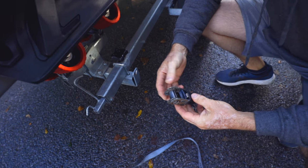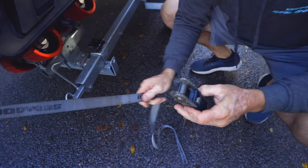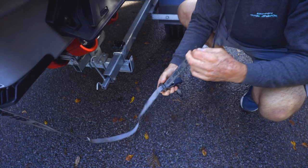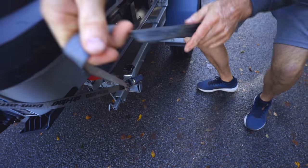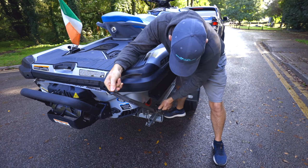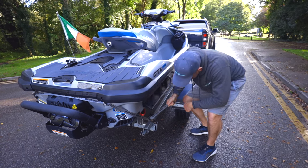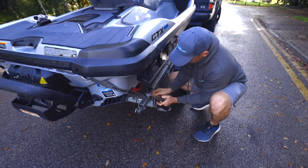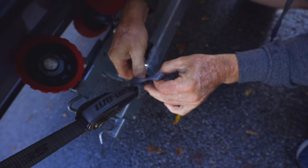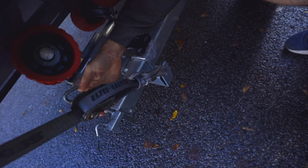When you put the strap through your ratchet, set it up so you can see through it from the top — keep it closed when you put it through. The reason you do it like that is when you push it through and pull it through, hook it on, and tension it up, you already have tension on the whole system so you only need to give it a couple of winds. If you do it the other way you over-wind it, the strap gets too tight and it won't work. As a little safety feature, once done bring your strap back down and through the eye of the trailer — that means if your ratchet strap fails for any reason, your strap is still coming through the trailer and you've got some safety there.